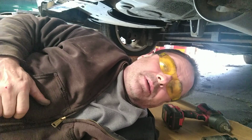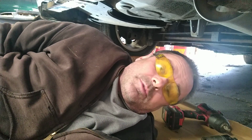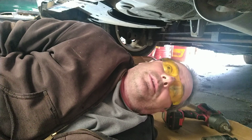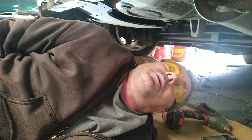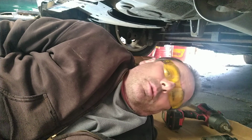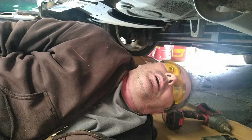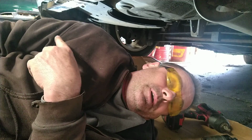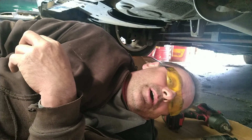Okay, so I was told by my assistant that it's called a fire wrench. I'm sorry for that. A fire wrench is an oxygen and acetylene torch. They call it the fire wrench. So I got it on. It was really designed very nicely. Whoever designed this hitch, they were right on the money. Those four bolts, like I said, the old ones were 15 millimeters. The new ones are 17 millimeters. I put Never-Seez on them. I had to cut that little hole out. If you want to do it properly, you should take the little plastic thing off.